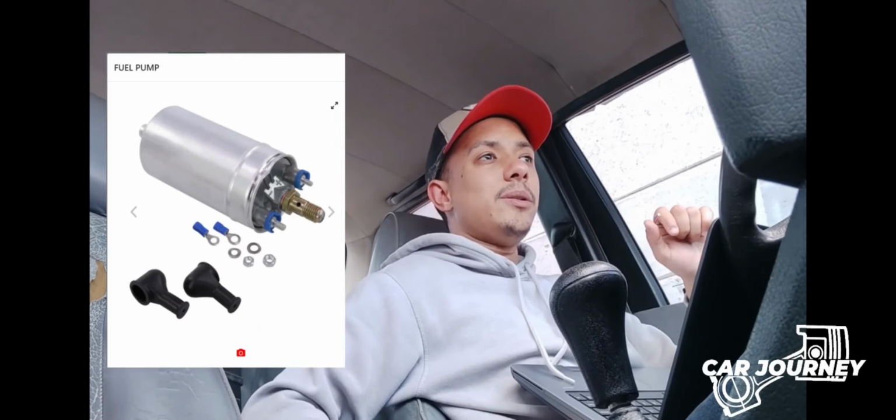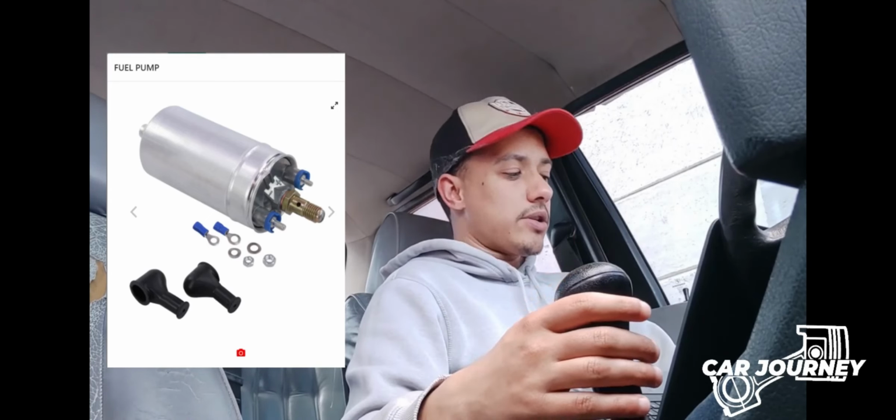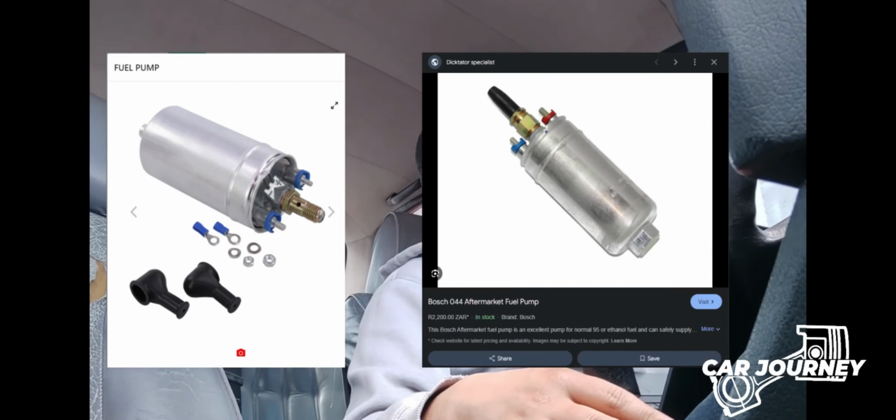So at this point, I prepped a Carrera pump. I saw online that the Carrera pump is loosely modeled after the Bosch 044 pumps, and that uses AN fittings. So I spent a good week just trying to find AN fittings for the car, and that I couldn't find, only to find out that the Carrera pumps that Volkswagen sells don't use AN fittings, they use Imperial fittings.